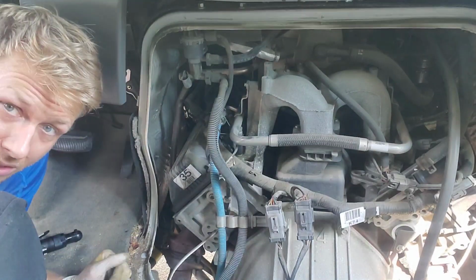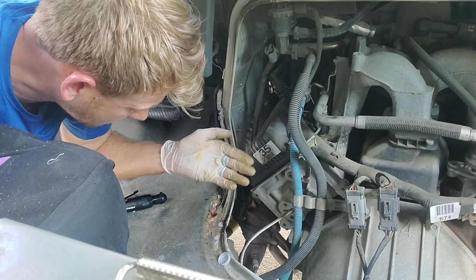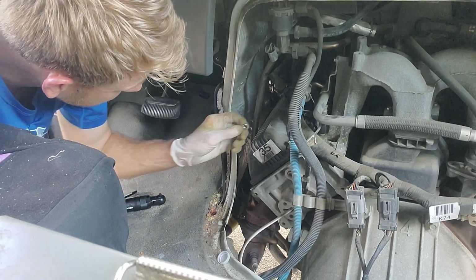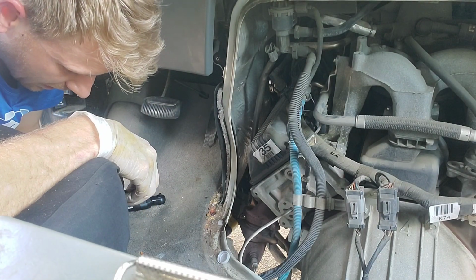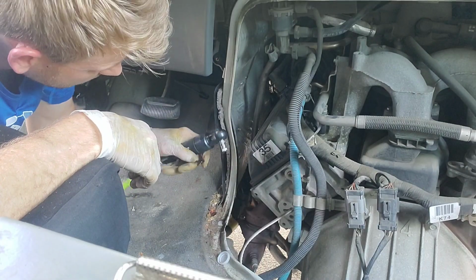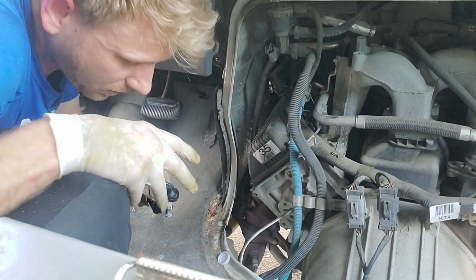Okay, I'm going to try my best to do this on camera. Number 7 is the second one forward from the driver's side rear here, and we got my parts, Motorcraft. Tools I think I'll need: ratchet. These should be 7s on the coils. Yeah, so the little bolt that holds the coil on Fords is a 7, and then got my spark plug socket and an extension and a hand ratchet to get the final tightening done. Got my little tiny guy here. It's probably not going to fit now that I've talked about it, but we will try our best. And now I'm going to run grab an extension with a little swivel.